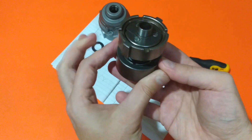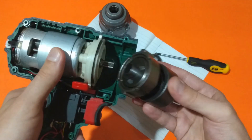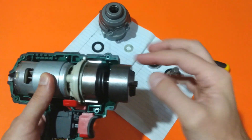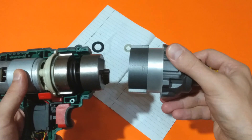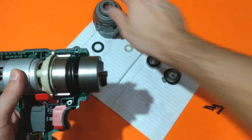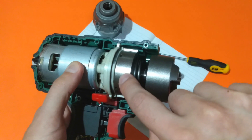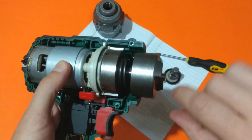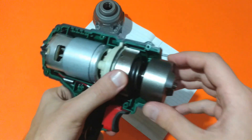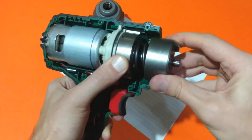Now let me show you how the whole assembly is realized. Here we have the metal casing which goes above everything. But you have to remember that the gear wheel is not moving — the only thing that is moving is the hammer, its shaft, the spring, and the sprockets. So when the motor is rotating, those are the parts that are rotating with its shaft.